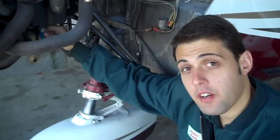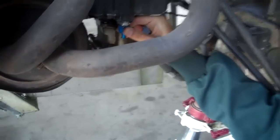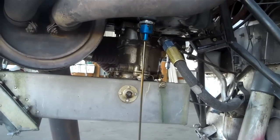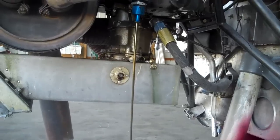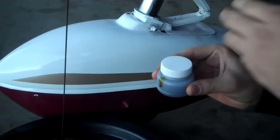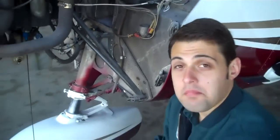We're going to go ahead and activate our quick drain on our engine to dispense of our oil. And during that time, we're going to let it run for a little bit. For those who like to use an oil analysis sample, we'll let it run to also prevent a high metal content in your oil analysis because of possible settling. So now we'll take that oil analysis, now that we got it. Good, we'll cap it, we'll label it, we'll send off our proper paperwork, and on we go. Until then, we'll let our oil drain, and we'll be ready to start removing our oil filter soon.